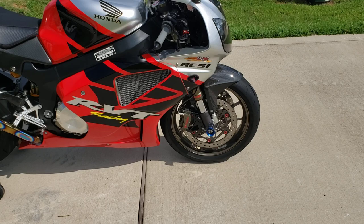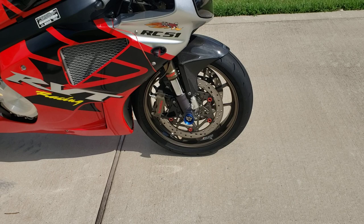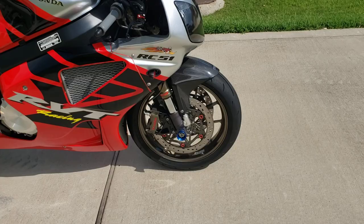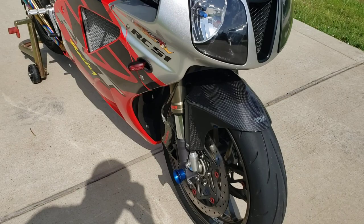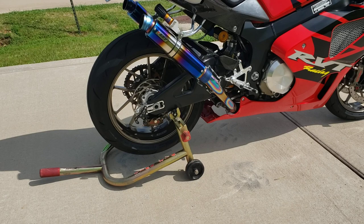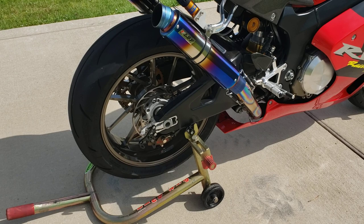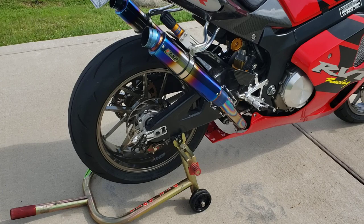Right now we're about 80% complete with the braking system on this bike — I'll get to why in a minute. We're running Brake Tech cast iron rotors, awesome rotors, Brembo HP billet aluminum calipers, Galfer superbike lines routed GP style around the fork. Had to order those custom from Galfer with a little bit of extra length so I could route them that way. In the back, another billet HP underslung caliper with a Galfer line as well. We've got a lightened rear rotor — it's pretty much just hollowed out, a lot of bikes will run these.